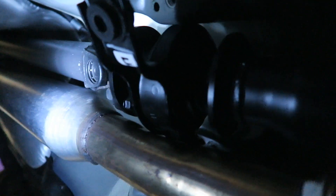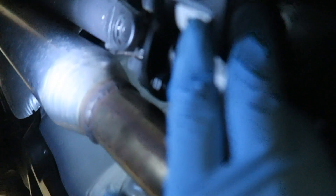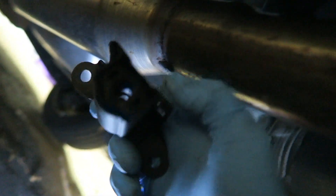A little side note: you're actually going to have to take the driveshaft two bolts out — they're 14 millimeter — and the ones that hold up the shifter are 13 mil. Basically after you take this down you'll be able to get in and take it out. I got the old one out, so let's go put the new one in.